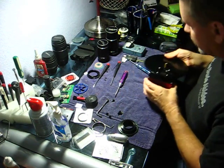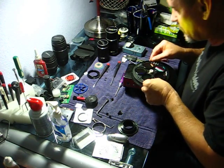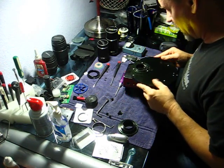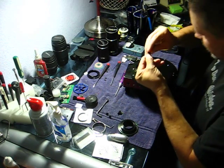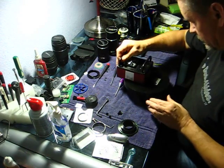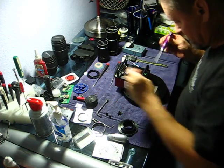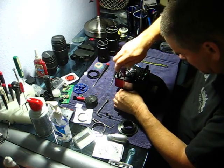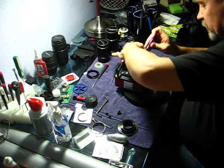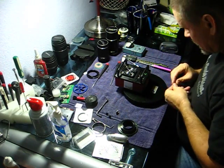Once that's done, take the filter wheel and set it in place, then take the rest of the unit and set it over the top. Align the center bolt, which will now be held in with this replacement screw, turn it over, and line up the screws. These two Allen head screws only need to go in the top, and the other three go in like so.